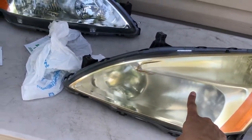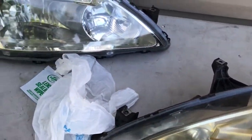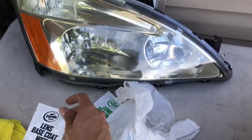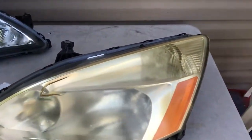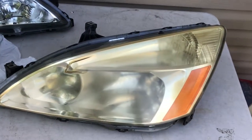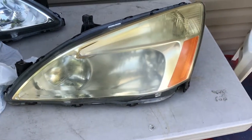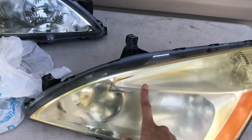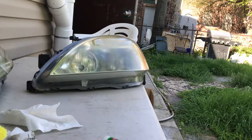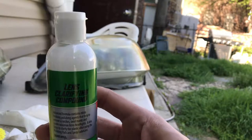I can't open the base coat wipe before I do both of them because it's only one pack and I got to use this one pack for both headlights. So I'm going to put my phone somewhere where you guys can see, or I might just go get my GoPro. But I'm going to start on this one and show you guys the process. Alright, so I cleaned up the headlight, now I'm going to apply the lens clarifying compound onto that headlight.